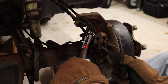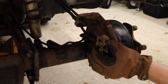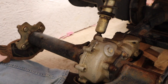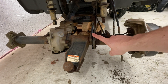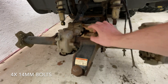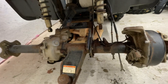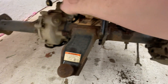I'm still thinking it's the splines on the axle for the ring gear that have gone. The seals in these drum brakes are more theoretical than anything — they fill up with water, the axle tubes fill up with water, and then the surface between the ring gear and the axle starts to corrode. It takes all the abuse and over time the splines just wear down. You'll need a new axle and a new ring gear. The fact that I don't hear any big crunches and you can easily spin it makes me think the splines where the ring gear meets the axle are totally smoked — just like mine.